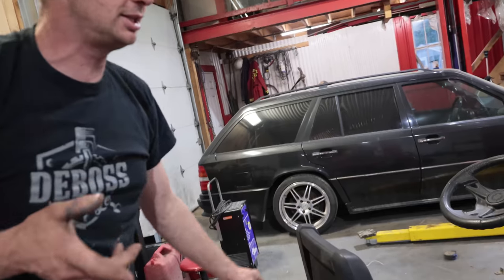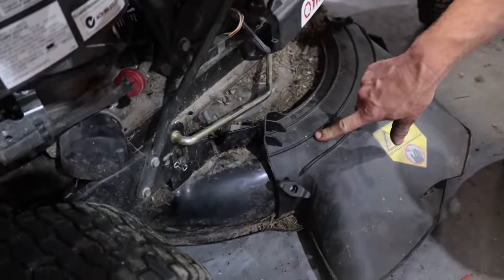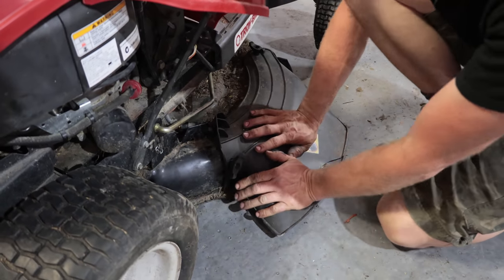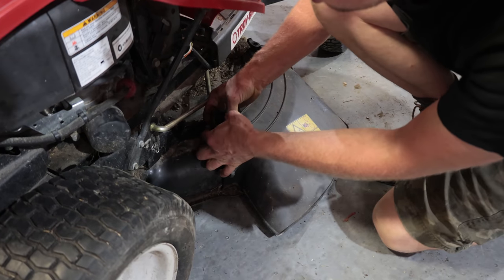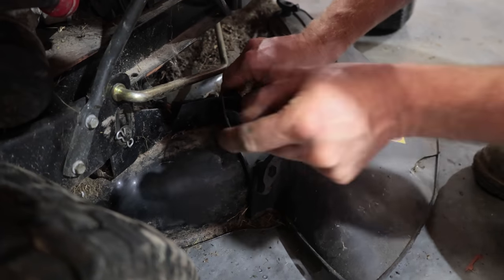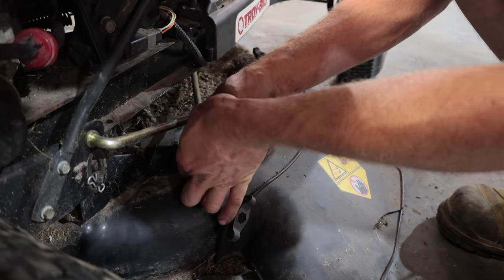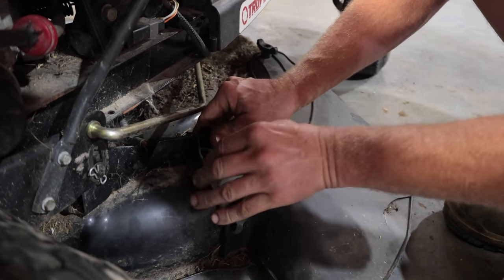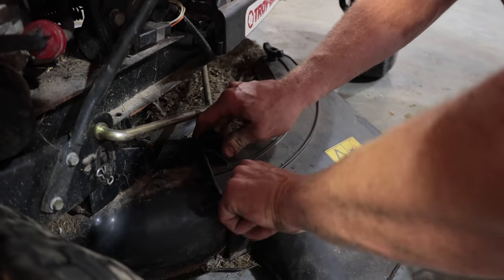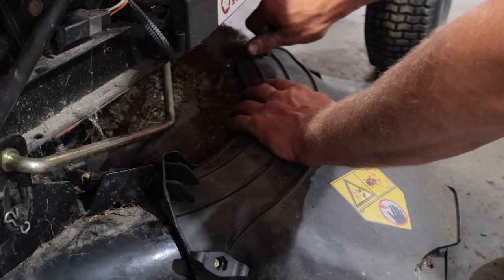What got me on this one is that there was also a safety on the cover. This is the first time I've seen this. While we were moving it into the trailer, we stepped on this and we jumped this plastic piece on this sensor. So it was actually this sensor that wasn't connected — somebody stood on it. Over the winter, that's more than likely to happen as you're getting a snowblower and putting your bikes and stuff away. So put that back in place, tighten this and see if it turns over.